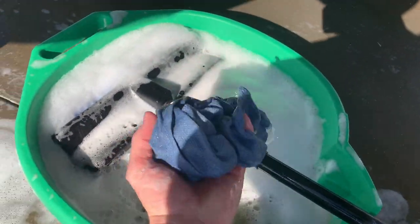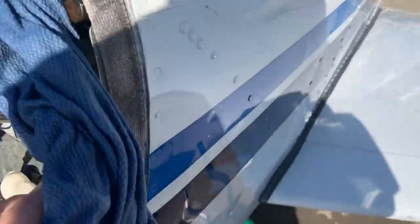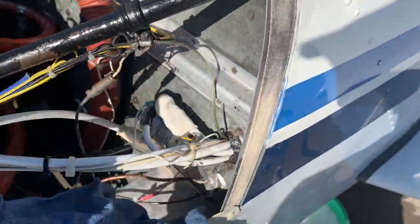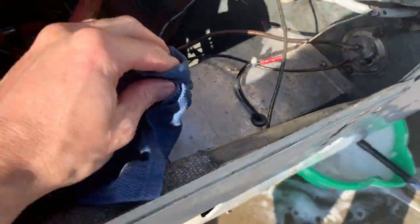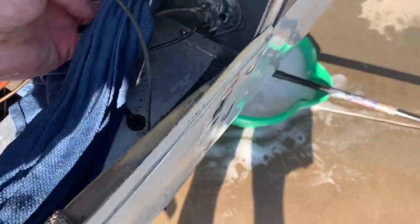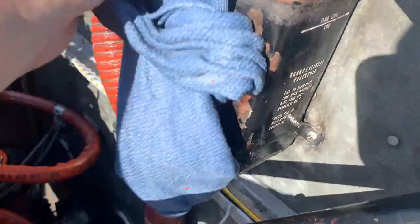10 minutes is up. So I'm going to take a soapy rag and all the areas that I sprayed, we're going to try to rinse off a little bit. It's really just some residue — like here on where the fuel pump sits, there's always a little bit of residue right there. So we're easy on the degreaser because I'm keeping it away from the electrics. I'd rather have a little bit of oil residue than have acting-up electronics.